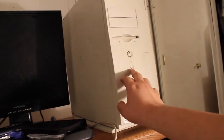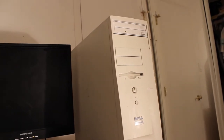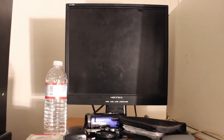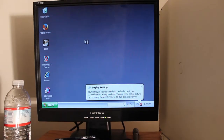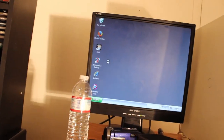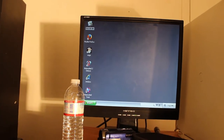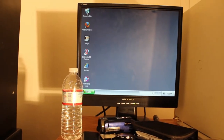If everything went proper and when I press this button it turns on — and everything seems to work fine. It posts and it should boot up into Windows XP. I'll update you guys when we're at the desktop. That hard drive does not sound healthy at all — listen to that thing. It's a Maxtor drive and Maxtor's not exactly the greatest hard drive. Man, this thing is riddled with viruses. It is slow. This drive may even be dying, or partitioned into like 75 one-gig partitions.